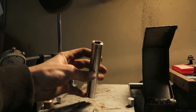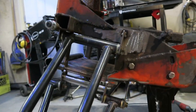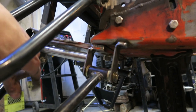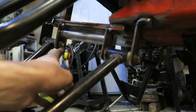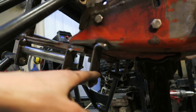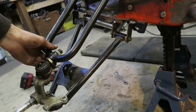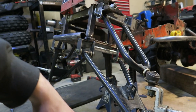So I was just on the lathe and I made a couple of these little guys. Nice little chunk of tubing, lathed down so she's got nice flush ends, and that little chunk is going to go in the opposite side. Now that I have all my brackets made, I need to start reinforcing them by adding a tube in between them so they can't bend. I'll also have a bracket on the back side and probably an angled bracket off the front. This should be nice and strong and work great. The lathe comes in handy just to make things nice and clean.